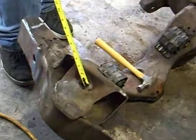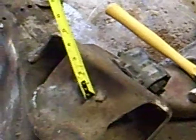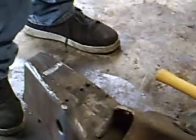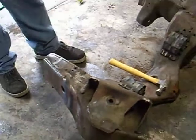And so, as I mentioned before, the front of this hole, as pertaining to the front of the car, the front of this hole is a shock. There's the shock bolts. That is center line. So you come back 12 inches from that point to mark it. And that's this point right here, so that's where it's going to weld to the frame. That's approximately where it's going to be welded around. So that's the point where I have to stretch.